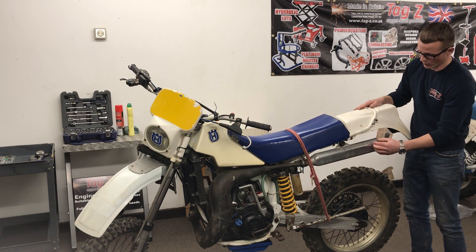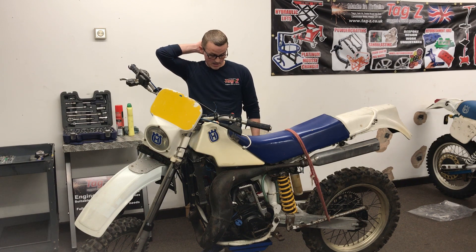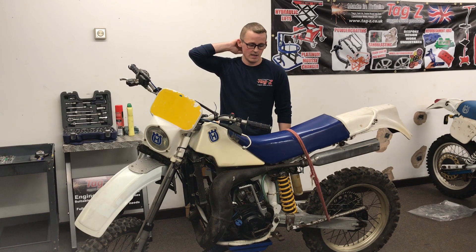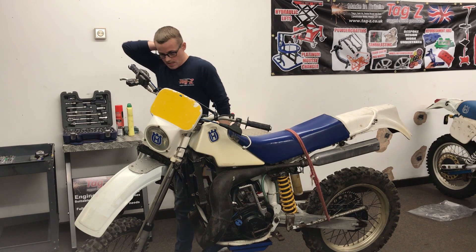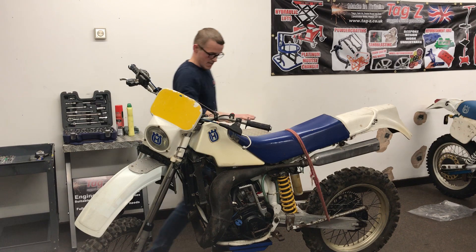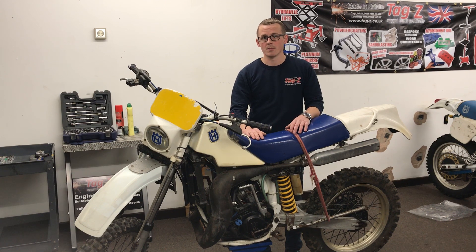There are some missing tabs on the side panel, so we'll fabricate those onto the frame before powder coating. He wants to keep the can but it's damaged around the end, so we'll take an inch out and drop it back in. Electrics are all a mess so we'll rip them all off and have a good going-over. We'll probably put a flatslide carb on it as well, just to give it a bit more life and stop it bogging down - flatslide carbs work a lot better than the round-slide carbs. The next video will likely show this starting to be assembled, and the one after that will be the engine strip.